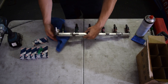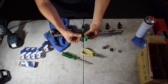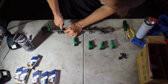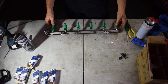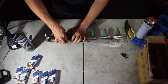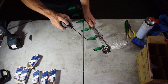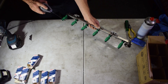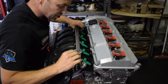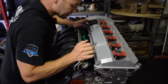We need to get the old injectors out. Wow, that's quite a difference — this is going to be such a good car. Put the clips back in using original clips. Lube the O-rings so they slip in nicely, then insert the new injectors — they fit like a glove.